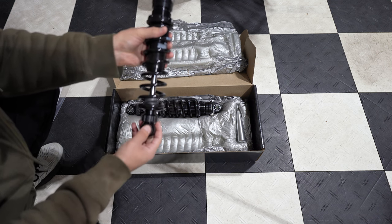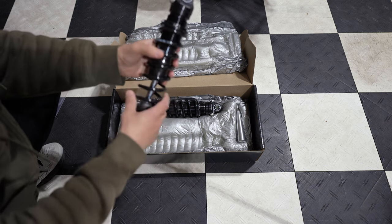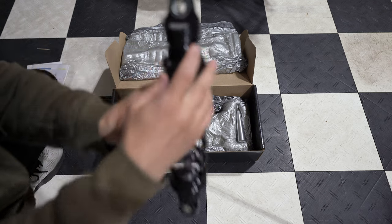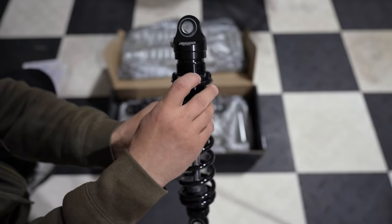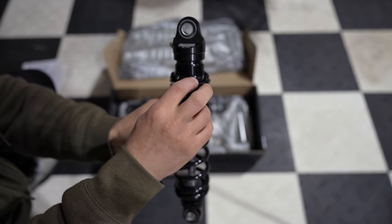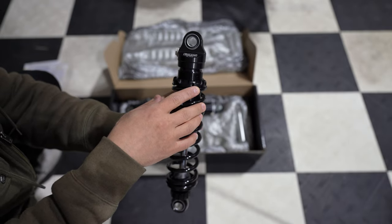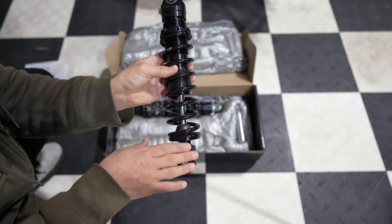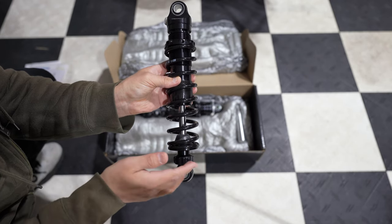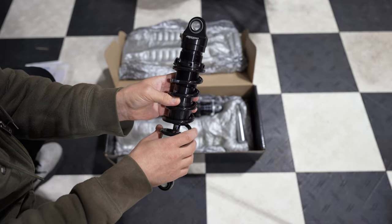They tell you to start with that and then make adjustments accordingly — opt for a little bit harder, or lower for a softer ride. According to the configurator, the measurement between the line and the adjuster ring should be 18 millimeters. I'm going to measure both to make sure they are within spec. I'll keep the rebound at 20 as it is from the factory, just set the preload, and get them installed on the bike.